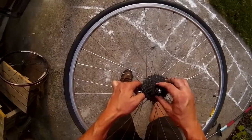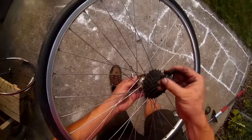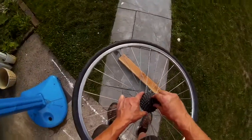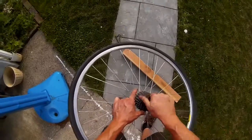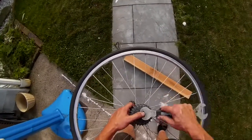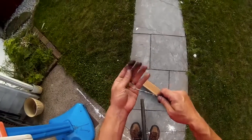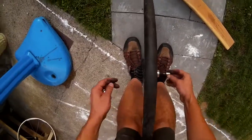Put all the pieces back on, put the nut back on. When you're pulling on and off that quick release, make sure that you don't lose the spring, and remember that the wide end of the coil goes outboard. Tighten that thing up hand tight with the tool and then turn it a little bit — there's probably some torque spec I'm supposed to know. Put that quick release back on properly with both of the springs, then you can install the wheel.